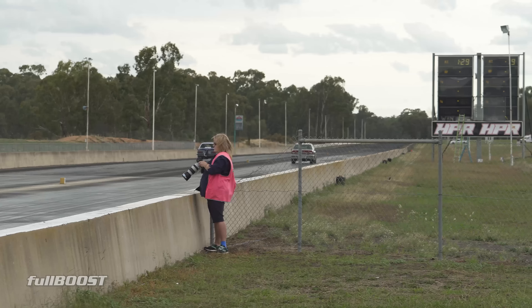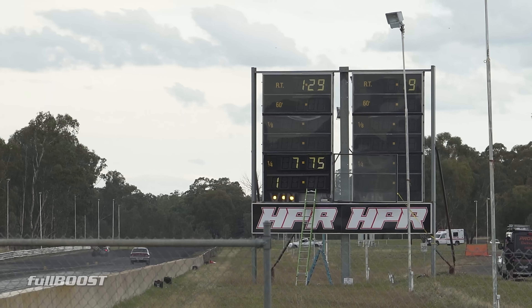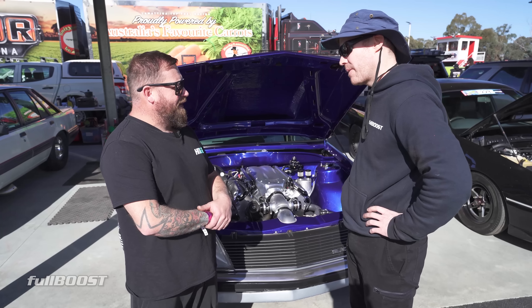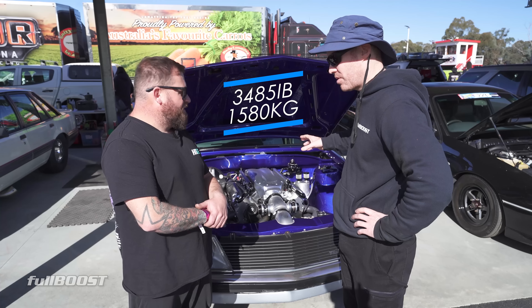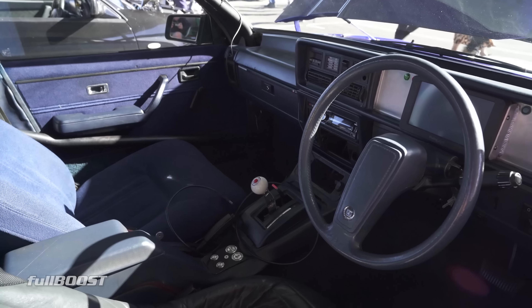Up under each guard. What are they? Give us a bit of a quick rundown of the setup. This is a bigger engine, isn't it? It is, it's a 440 Dart, still hydraulic roller cam, standard rocker gear, set of Powerhouse Engines heads. Just off the shelf, they're six bolt heads, still unported, running twin G42s.